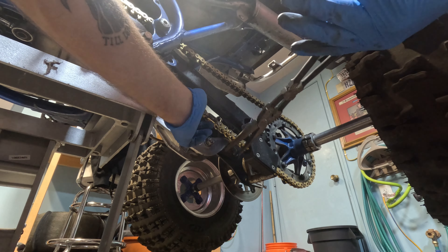All right, on to step three. Now that we have the new chain and the oil changed, it's going to be checking the compression. That involves taking off the spark plug boots, removing the spark plugs, and putting in a compression tester. This is basically just checking the health of your top end. Your reeds can be cracked, it does have low compression, your rings inside the pistons could be failing. Things break down — it is a machine after all. The process is pretty easy.